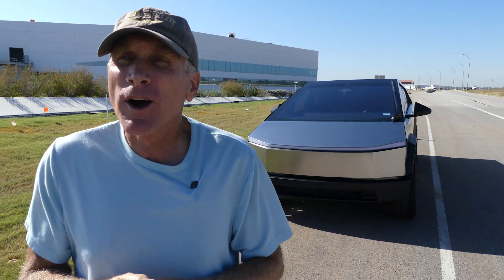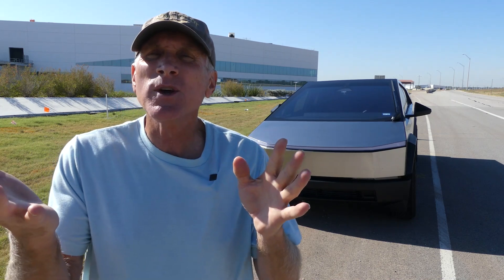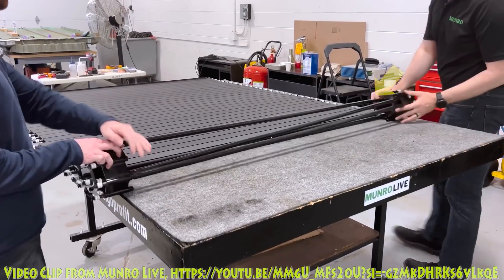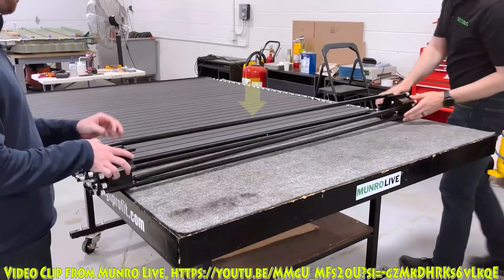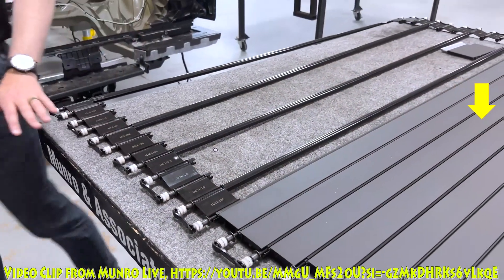What I heard from the repairman at the Tesla sales and service location here in San Antonio was that where the tonneau cover retracts in, there's kind of a bolt-type structure that it rolls up in. On two places, there are rods that go along this cylindrical receptacle for the tonneau cover. There's a noise, vibration, and harshness pad that's supposed to be around those rods. What was happening in my particular case is one of the rods was slightly bent, which means it was touching that part of the tonneau cover, and every time it rolled down, it was scraping it along and causing that problem.